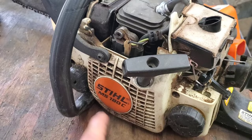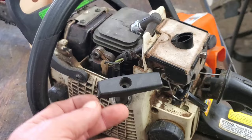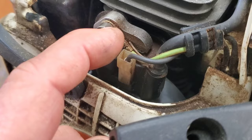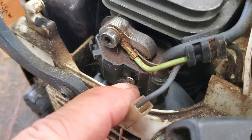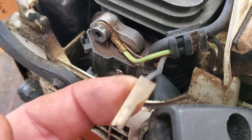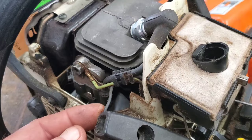As far as chainsaws, some of them you'll have to remove the cover to do what I'm about to show you, which is just a few screws. Then you can disconnect the wire, put the cover back on, do the same procedure — pull it over and see if you've got spark or not. In this case this one has a ground wire. All you'll do is disconnect that wire; it's got the same kind of little terminal there. That's your kill terminal. With this disconnected, you have eliminated all the wiring. New spark plug or screwdriver, lay it up here on the head, pull the engine over — same deal.